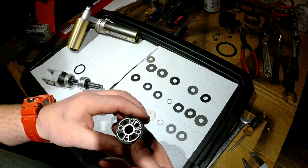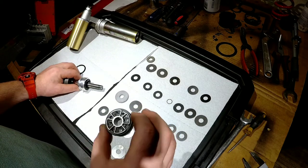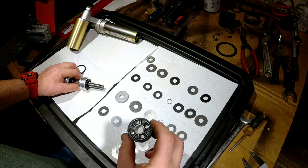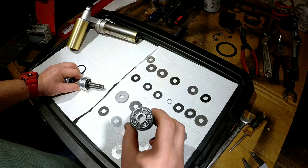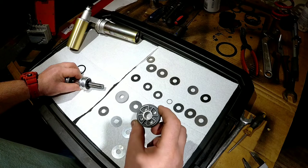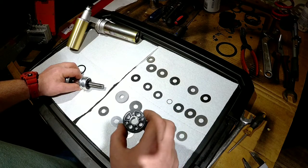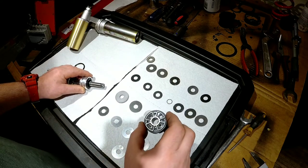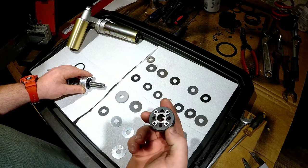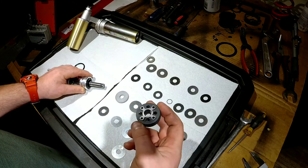What's behind the very small ports is, I believe, a safety in case you hit such a dramatic bump, like a pothole, fully loaded, maybe at higher speeds. Once you manage to crack open that heavy stack, with so many shims, you literally go to the orifice. The size of the hole in the piston will not allow any bigger flow than what they decided through testing as a safety factor. So we drilled this a little bit bigger. Now they're going to flow a little bit more, and we're going to rely more on the shim stack than on the orifices or the piston itself.